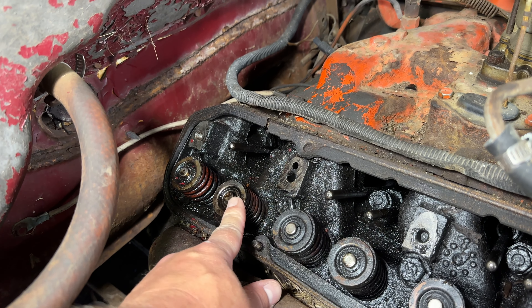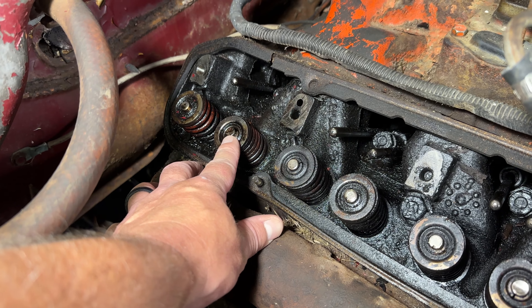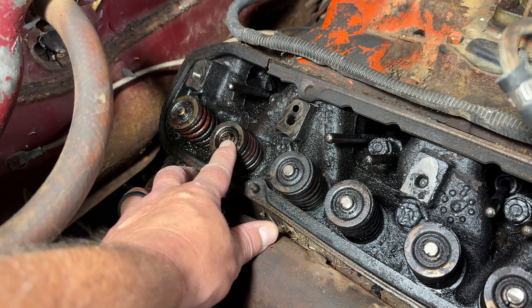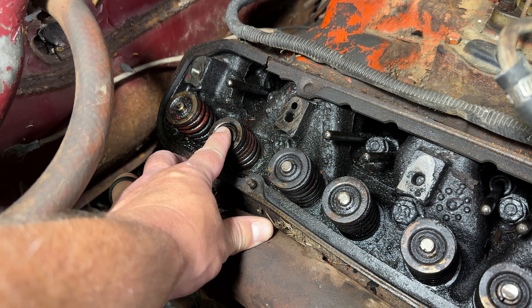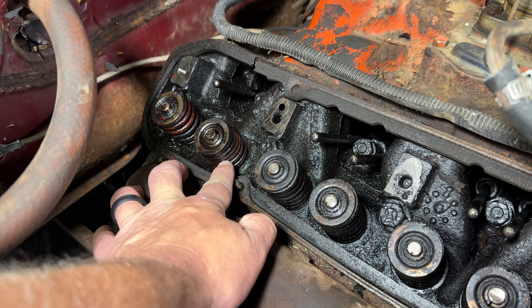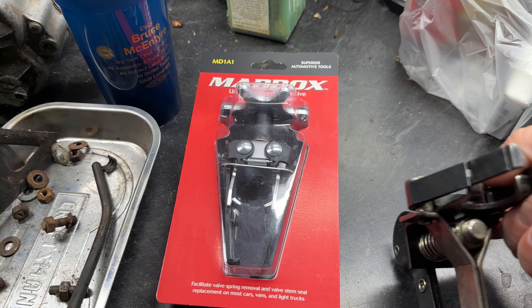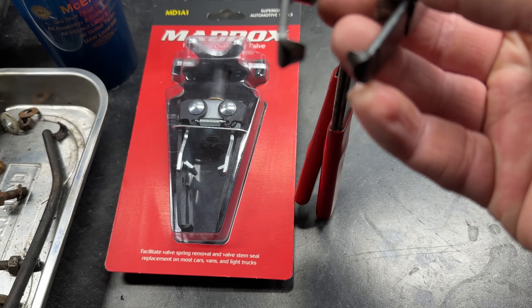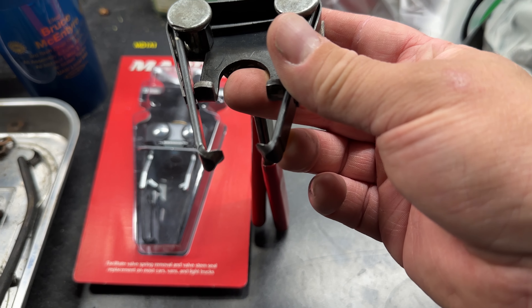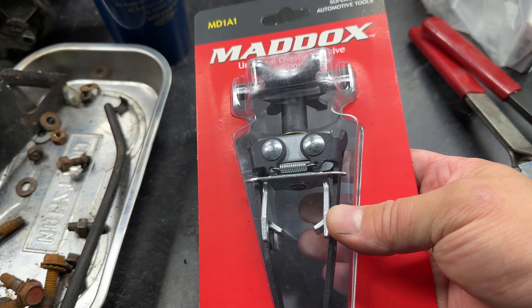Let me give you a little backstory. This valve — I actually had the spring off. If you watched the previous video, I had the spring off and was using the lever type valve spring compressor. When I went to put it back on, I had tapped this down with the brass drift. I pushed it down too far and I can't pull it back up, so I'm having a hard time putting the keeper in the valve because it's getting pretty close to coil bind. So I bought this El Cheapo Harbor Freight valve spring compressor. The lever type has real big jaws and I was wondering if that was interfering with the last coil, so I'm going to try this one. Looks like more Chinesium, but we'll see.